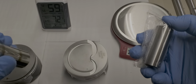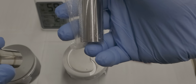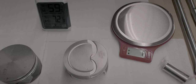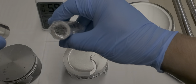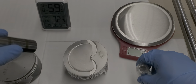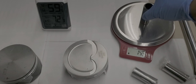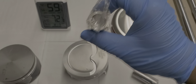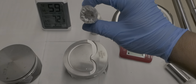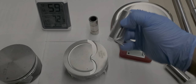But if I plan to make more power and more boost, and also for peace of mind, I decided to reorder and get the thicker ones. The original pins are 0.150 wall thickness. The thicker replacement pins are just about the same thickness as the stock ones, if not a little more. In weight, the stock pin comes in at about 145 grams, the skinnier-wall first set was 106 grams, and the thicker replacement is 132 grams — still 14 grams lighter than stock.